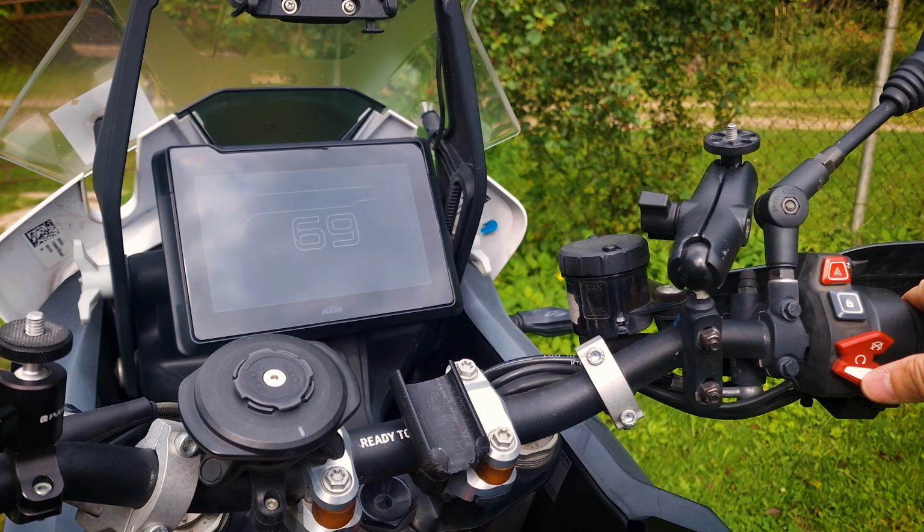I wanted to connect to this sensor to see exactly what it was reading, so I used two regular needles to do this. I hooked them through the cable seals and I got to the connector pins. By the way, never pierce the wire insulation or the wires will rot.